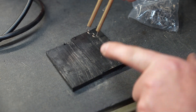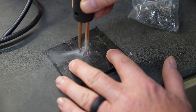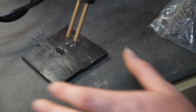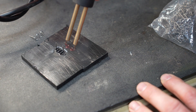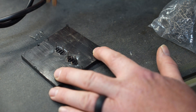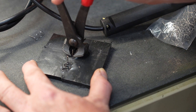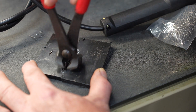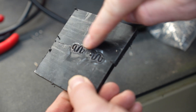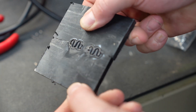The hot stapler is on and the staple starts to glow. You put it right over the crack and melt the staple down into the material, then let go of the button, let it cool off just a little bit, and pick up the tool. We'll do one more — hold the button down, it starts to turn red, put it down on the crack, let go of the button, pull the tool off and the staple's left behind. At that point, you can take zero-clearance cutters and cut the little legs off. That keeps two pieces of plastic held very tightly and securely. You can also sand it down, use a plastic welder to fill it, or use Bondo — but the connection itself is very solid and sturdy.